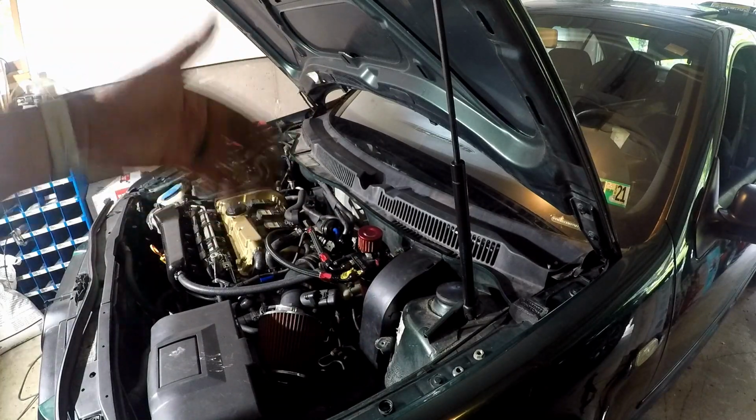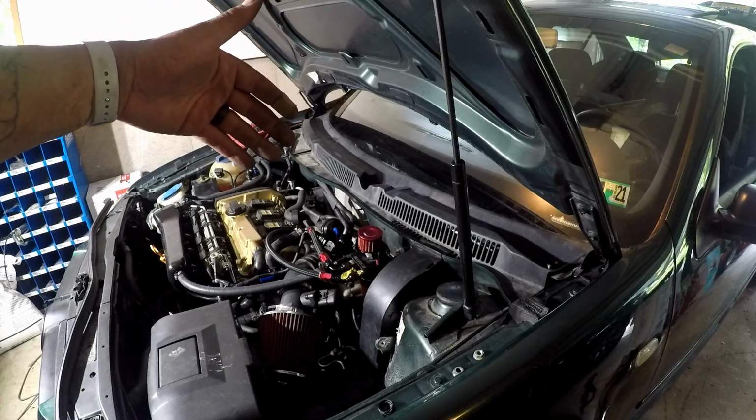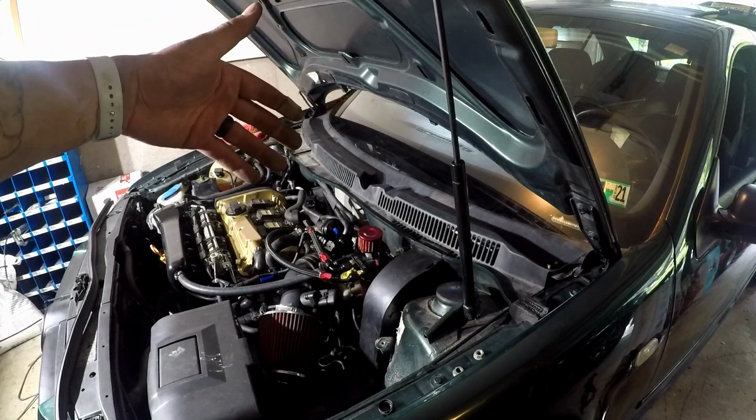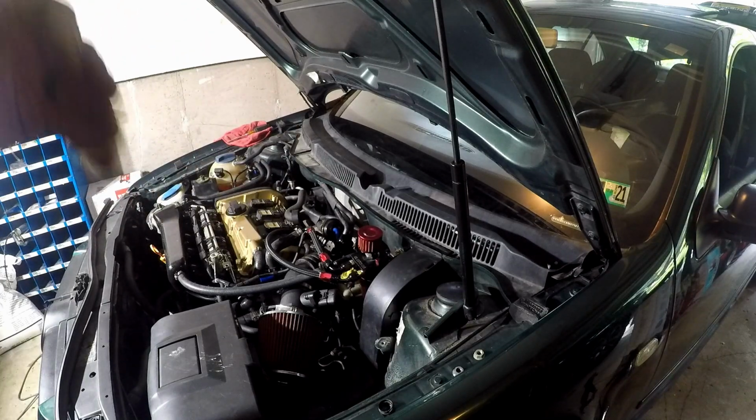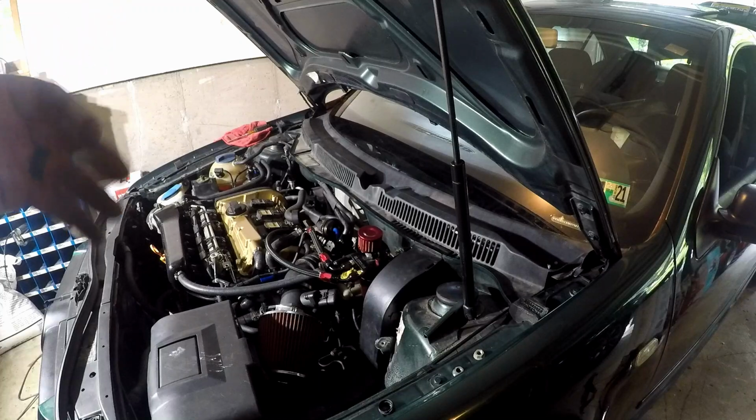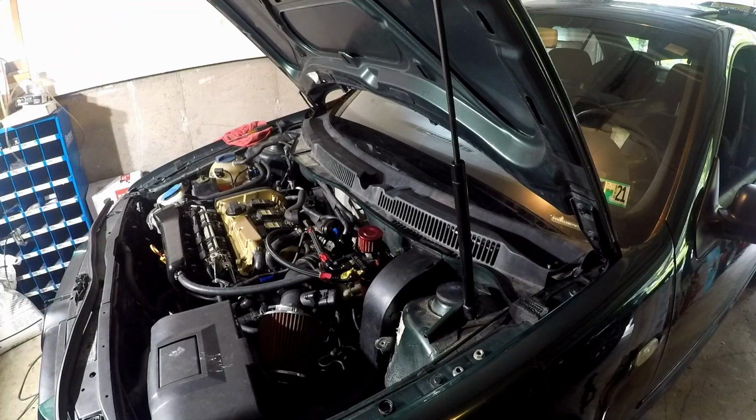So now the only thing left to do is in reverse, put your wiper arms back on with the 13mm nuts, about hand tight with like another quarter to half turn, not too hard because then you'll break your windshield, and then that's it, you're good to go.